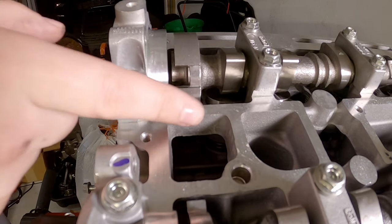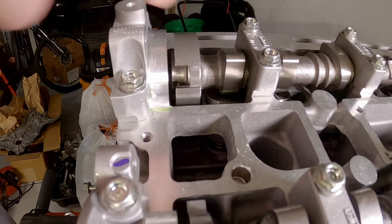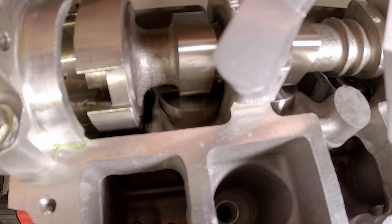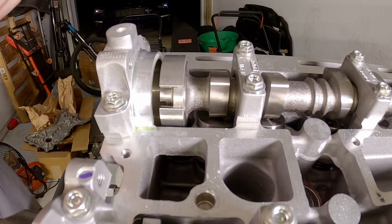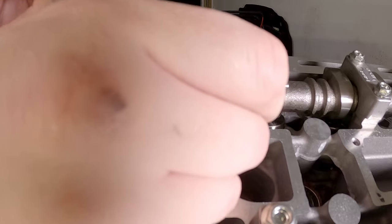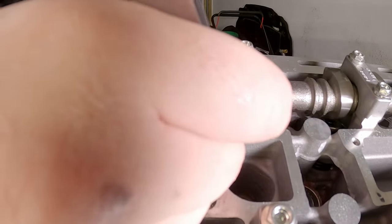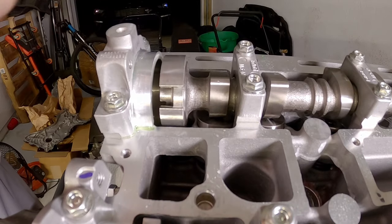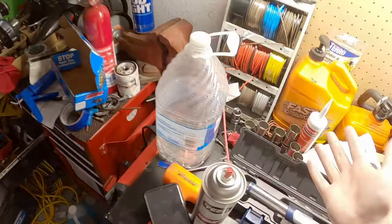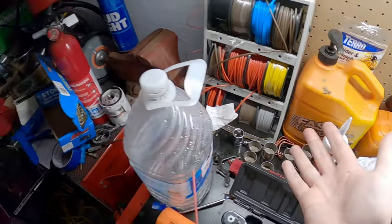You can see the cam bucket right there on the intake cam. The acceptable clearances span these three feeler gauges here - going back to our 0.30 millimeter gauge, it just grabs a little bit but not much. The nominal should be around 0.25mm. I'm going to have to take my time and do this for the whole head. There is a difference between intake and exhaust clearances, and differences between individual lobes, which is exactly why the factory engine had so many different bucket sizes.